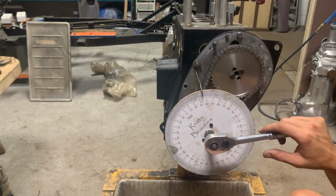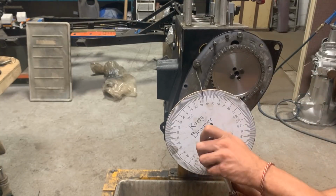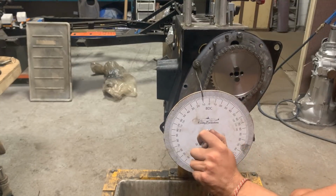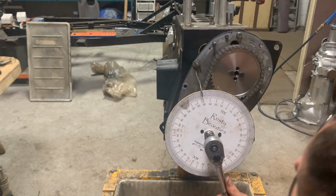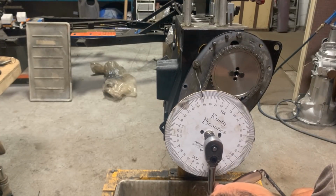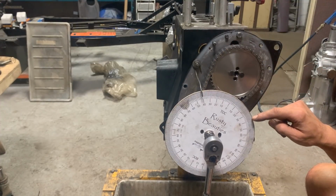These are not real, but in the current setup, the way the wheel is installed on the crankshaft, it points 35 degrees. That's what's important for us. So now we can go the other direction, counterclockwise, until the piston hits the stop again, without moving the piston stop, of course. Wow, that's pretty close. So on this side, it stopped at, what is this? 41 degrees. So we know that our true top dead center is exactly between 41 after top dead center and 35 before top dead center.